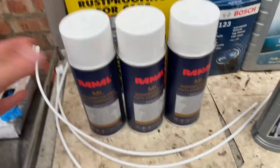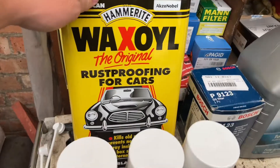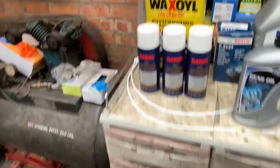As you'll have seen — well, what I had mentioned — this is what you call cavity seal. Obviously you've got your wax oil, which you just spray underneath the car using high pressure air. But naturally you can't get into all the little cracks and crevices, like all the inside skins of these bonnets, the bottoms of the doors, the boot, inside all the box sections, the chassis, stuff like that. So that's what you use these for.